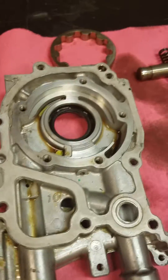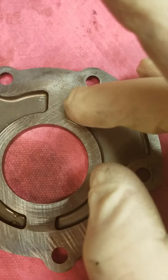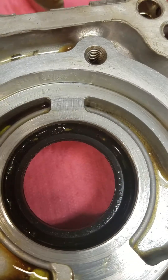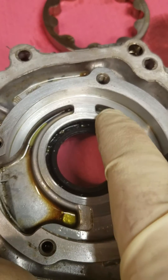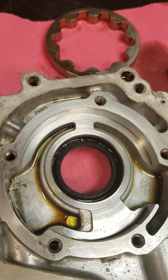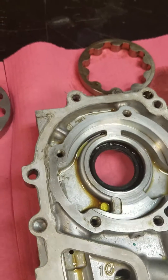There are some problems you can see here. This is a fairly high mileage OEM pump. You can see some scoring in between the low pressure and high pressure stages of the pump, and also on the backing plate if you look closely. If these grooves get deep enough that you can really feel them with your fingernail or they're pretty gouged, that can cause problems because it allows high pressure to bleed into the low pressure zone and cause a reduction in oil pressure. If your pump has sucked something through and created a large gouge, I would definitely recommend not using that pump.